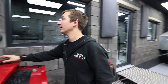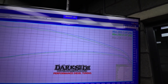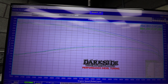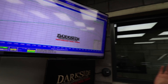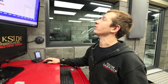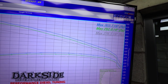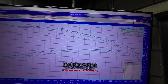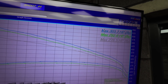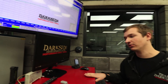The 276 is what it did when it had done about 300 miles on the dyno with this exact same tune. Then the last time we got it in we ended up with 296 or something - but that's irrelevant for this comparison. The 292 you can see in the green lines is with the DPF blocked up a little bit. The 303 is with the DPF regenerated, and it's still getting about 600-700 millibar back pressure.